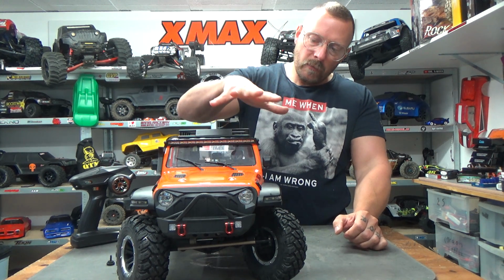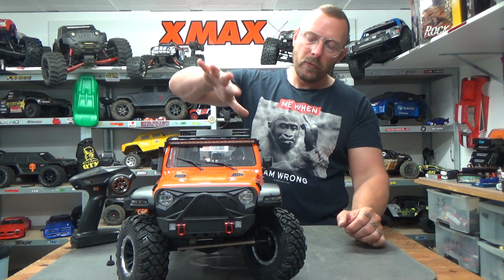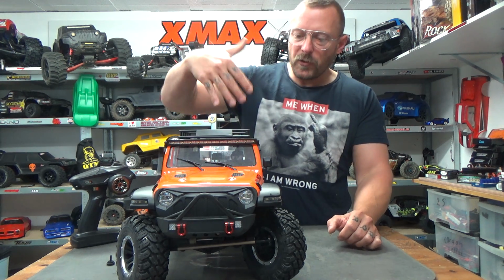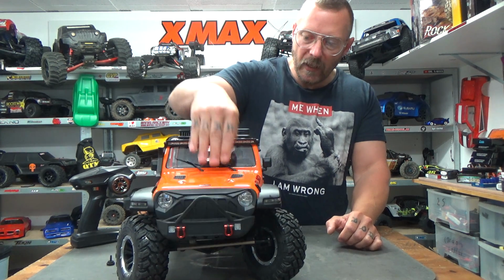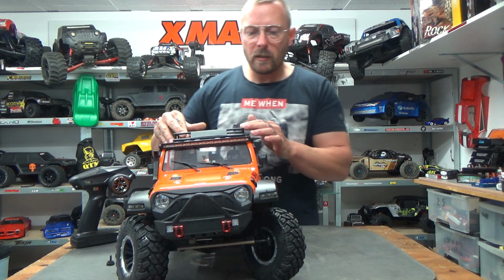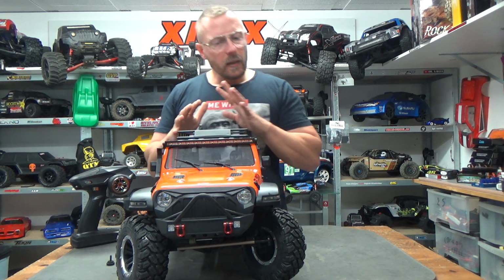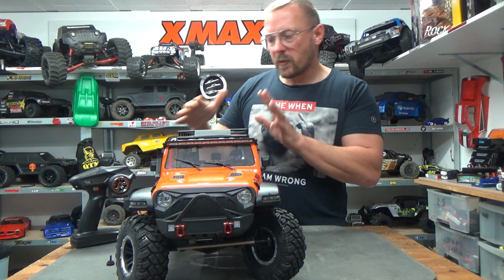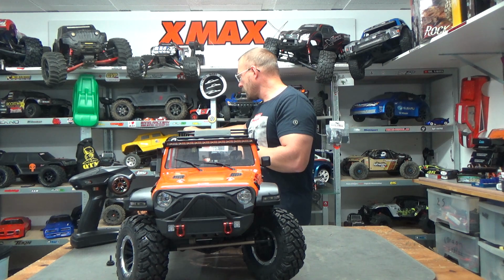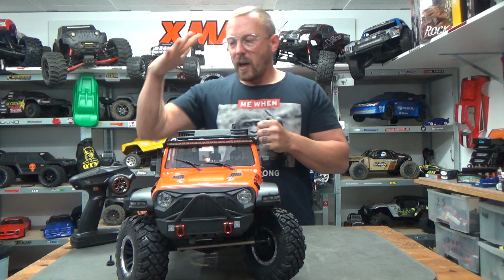If you put a little bit thicker oil in, you have less roll, which is really important when you drive off-road sidewise. You have the issue with the Corolla that you have a front and rear hard suspension when you hit both. There they chose to go soft front and rear, so it seems a little bit too soft, but I just quickly drive it here. Seems to be good. We're gonna see what happens off-road. The TRX4 has a difference here. They put thicker oil, so it's really bumpy. When you drive, it's jumpy around.